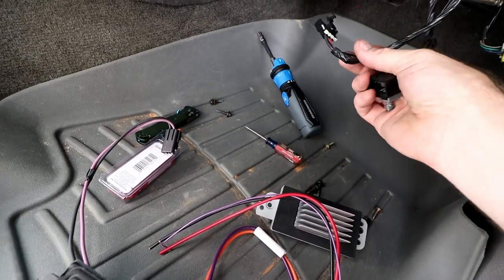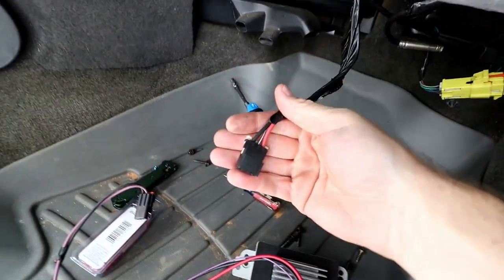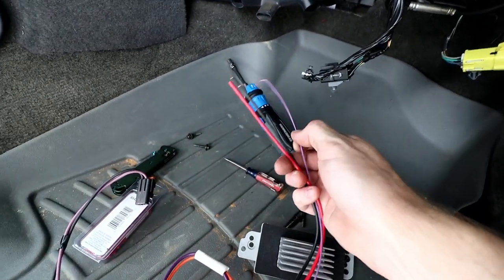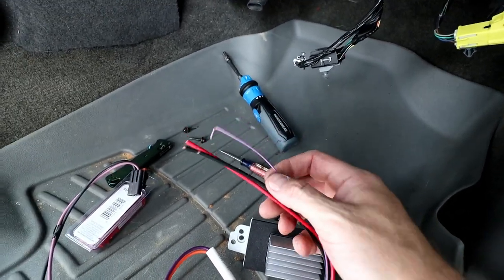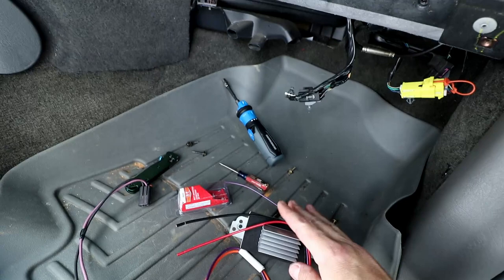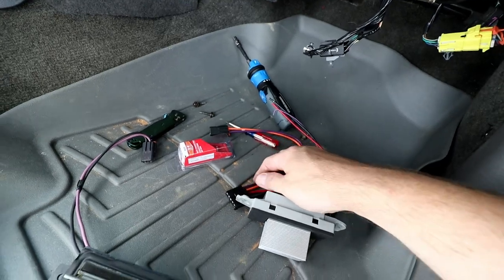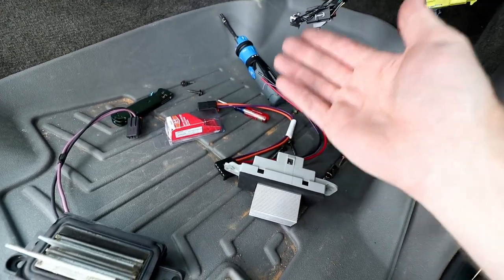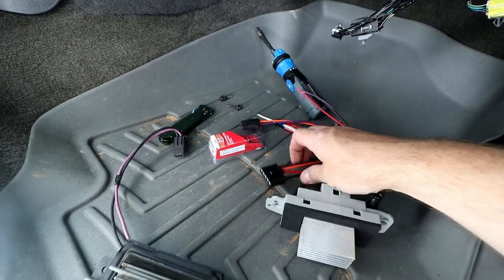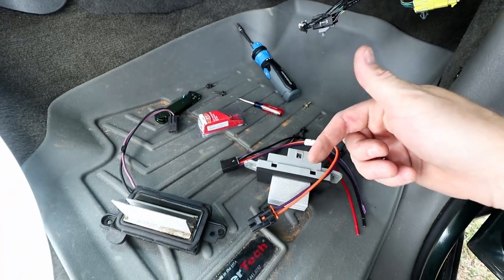Let me show you guys the wires that we have to cut and splice. Here is the connector to the old module. On this connector there is a red wire, a black wire, and a purple with a white stripe. And then on the new harness, we have the same wires — black, red, purple. We're just going to splice these and connect them with the butt connectors. I'm not going to go through an in-depth diagnostic test on voltage — there's a really great video by a YouTube channel called No Nonsense Know How. I'll leave a link to his channel down in the description below if you need to do a diagnostic on voltage and voltage drops on these connectors.